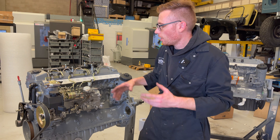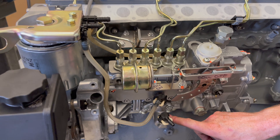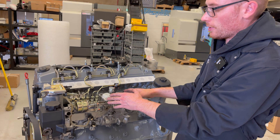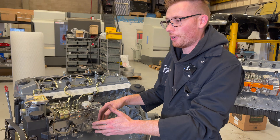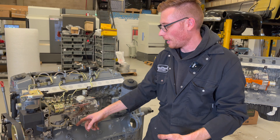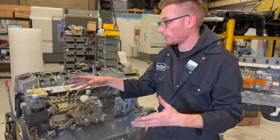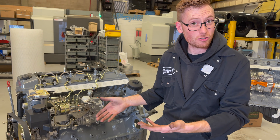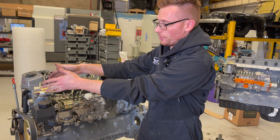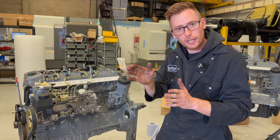Let me show you how to pipe this system up. This is the original EDC filter head that would have come with this turbo engine. And this is the original EDC lift pump that also would have come with this engine. The mechanical pumps and EDC pumps both have the same type of lift pump fitment — both two bolts, operated off the cam. The pipework and the filter head works with both, which is really good. We reconditioned this pump when we did the injector pump, and we also reconditioned that.